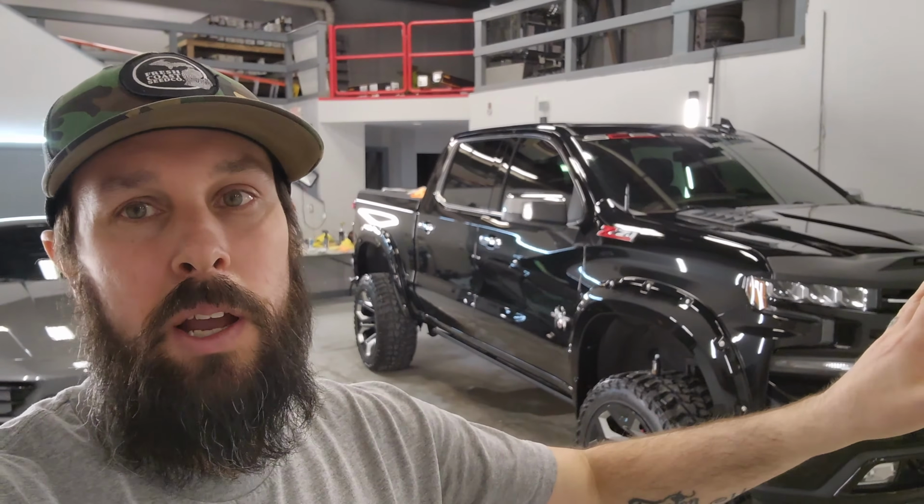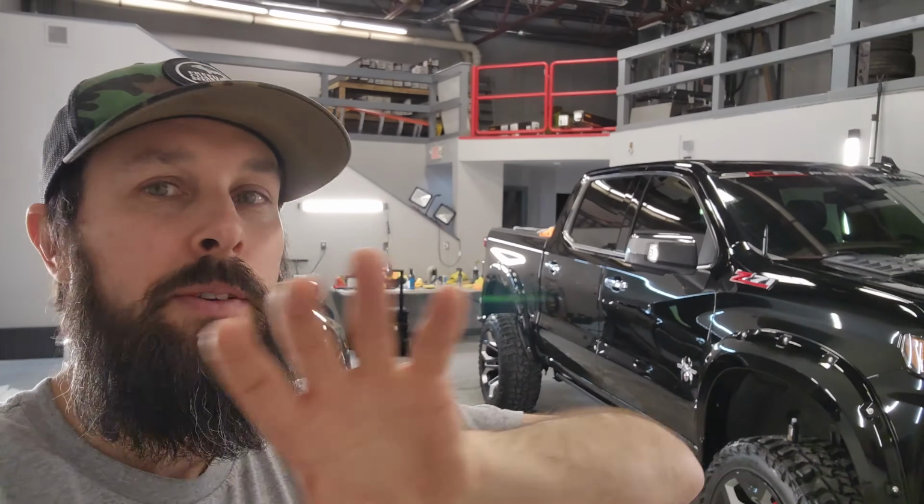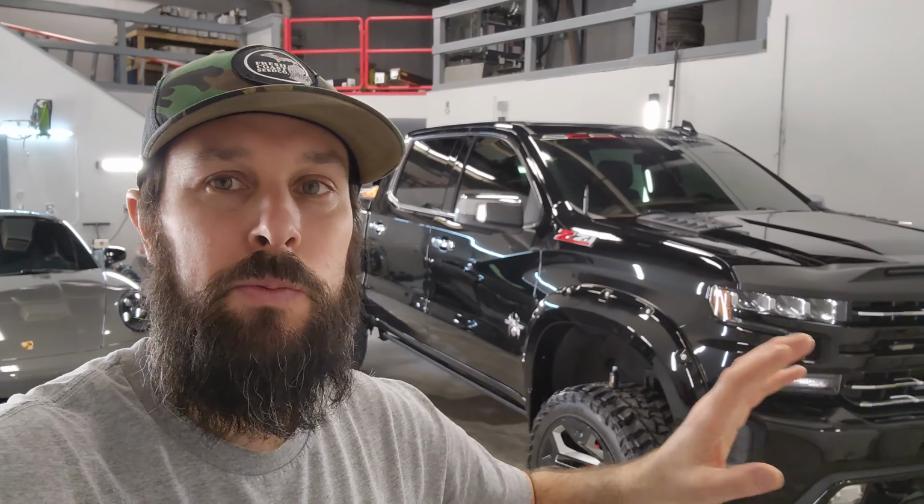You know, a CarPro product, you can come back a half hour later. If you find a high spot, you can wipe it off. This, you come back and find a high spot, you're polishing it. And the way I do it, if I ever find a high spot, which does happen, I just repolish the entire panel and recoat the entire thing, because you'll get a spot, you can see where the polish went across it. So you got to be really diligent.